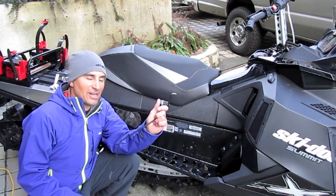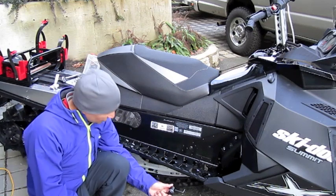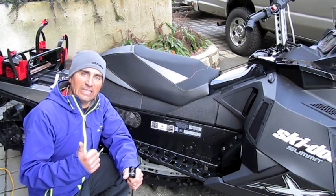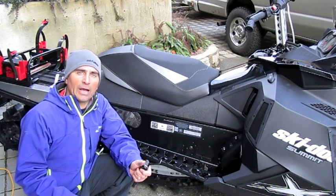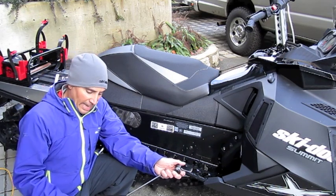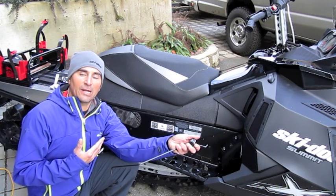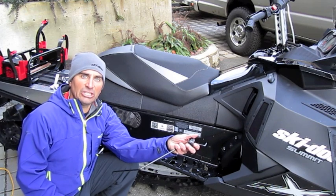For those of you who don't know what scratchers are, this is what a scratcher looks like — it's just a piece of aluminum that attaches to your skid. On those days when it's icy or it's a frozen morning and you've got a long road up, you just release the scratcher off the side of your skid and it hits the hard snow and ice, kicking it up into your heat exchanger under your tunnel, therefore keeping your machine cool.